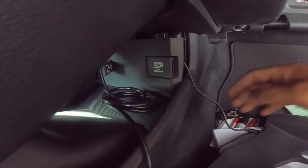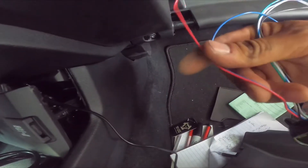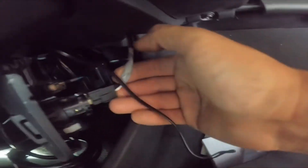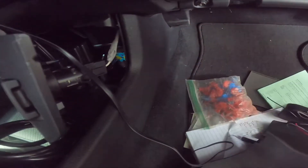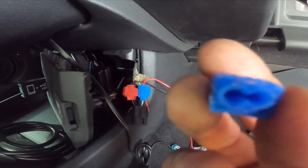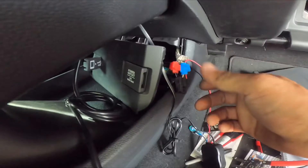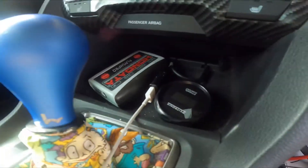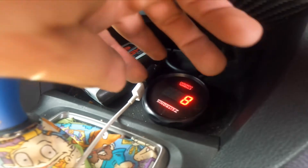This is the harness — I just need to hide it and grab power and ground, which is red and black. I have some vampire clips — I don't want to splice into the wiring so I can just pinch it and that's it. I don't really want to mess too much with the electrical in this car yet. These vampire clips can be tricky — sometimes they don't splice through the wire, or sometimes they cut the wire.